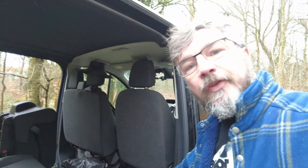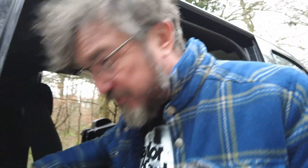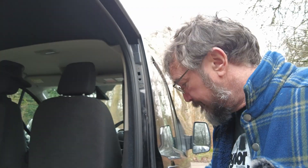Big problem with this van though is as soon as you touch a door the van comes alive, so it's very easy to flatten the battery. It's only got the battery underneath the driver's seat - just a single battery - so something I need to do is get a twin battery system fitted. I've been places and had the doors open and the battery's gone flat. The only way to stop it is by actually latching the door, and then the van thinks it's shut. I don't know why Ford did that - ridiculous idea.